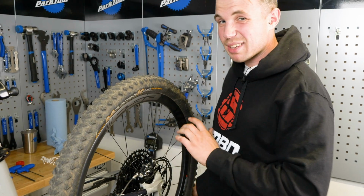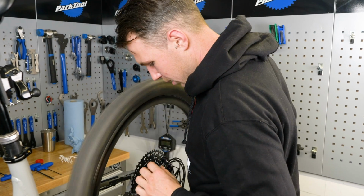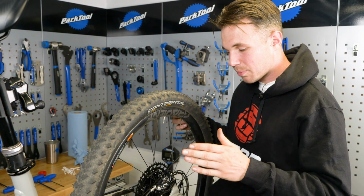So I'm actually taking no notice of what the pads are doing, and I'm getting that rotor centered exactly in the caliper. It spins freely because the pads aren't out at all, but it's well and truly square.